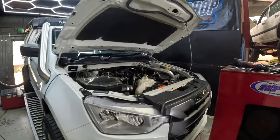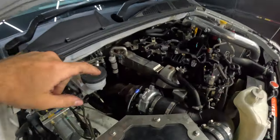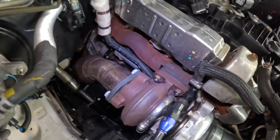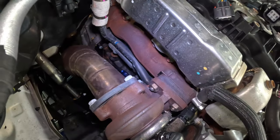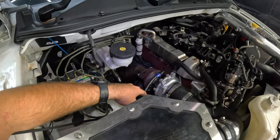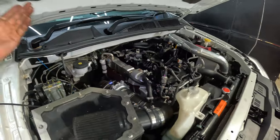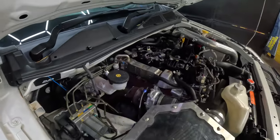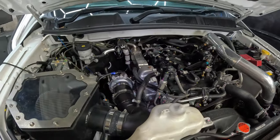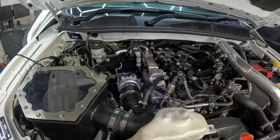What we've done starts in the engine bay and underneath the vehicle, because we did our PKS 44mm turbo upgrade to this car. It's not a direct bolt-on turbocharger option — it does take a flange and there's a little bit of modifying in terms of dump pipe, inlet pipe, and some other things. But they do fit. They're a very common turbo we've used on 4JJ1s in past years, so to apply them into the 4JJ3s has been a fantastic choice — a no-brainer. The PKS brand is something we've been selling for a very long time and we've had no issues at all.